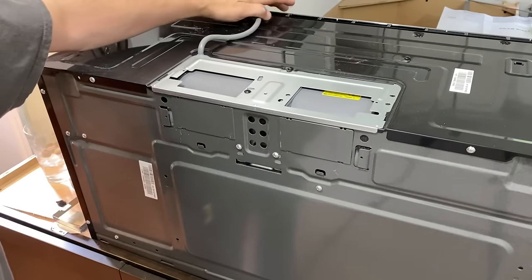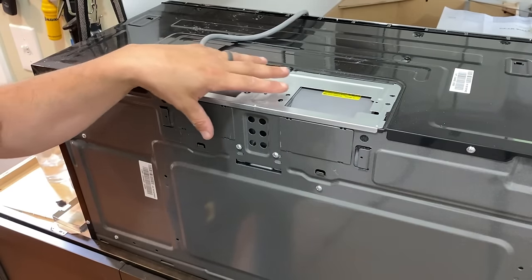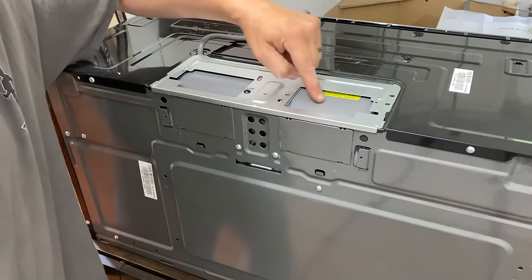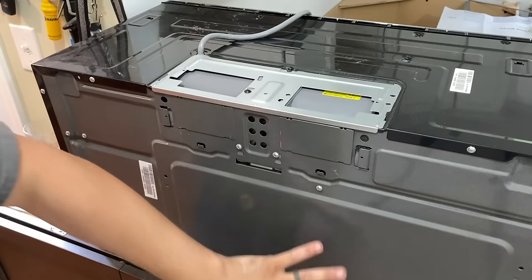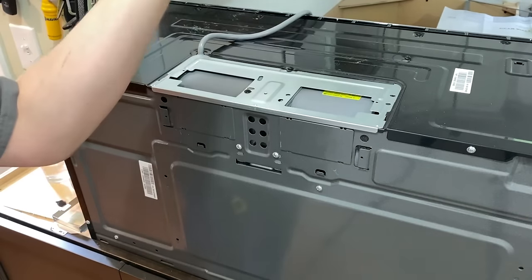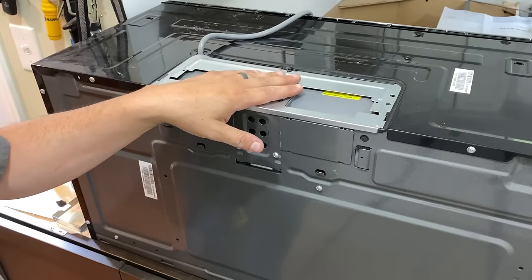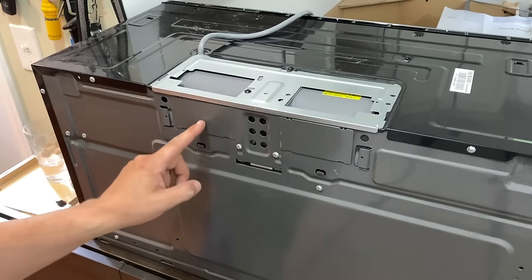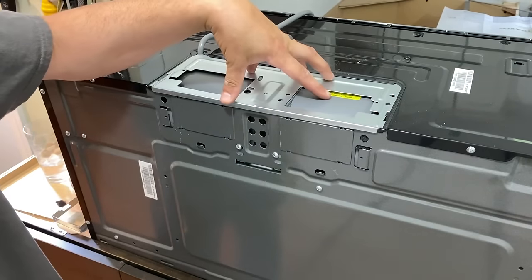We have to move the blower. This microwave has three different venting configurations. Right now it's set up for self-venting — air is sucked in through the bottom and blown out the top, basically just filtering and recirculating back into the kitchen. The second way is upward, for going through the cabinet to a roof vent or wall vent that way. The third, which is what I'm doing, is a wall vent out the back. It looks blocked, but those are just knockouts you have to remove. I'm going to flip the blower for the back wall vent configuration.